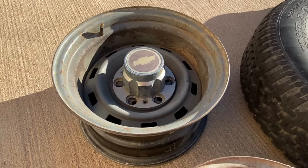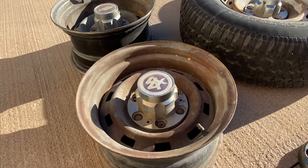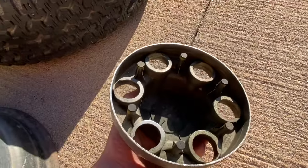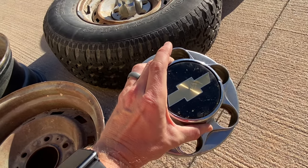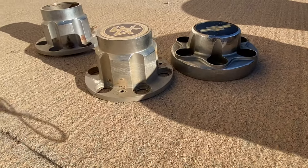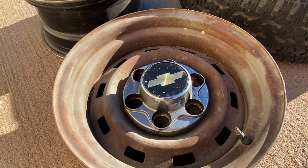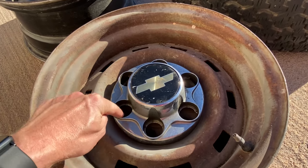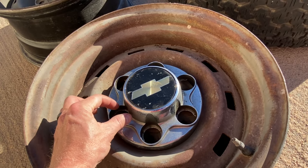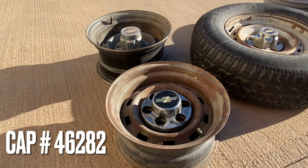It's not that bad if you ask me, but if you put these on a 15x7, I just think it looks terrible. An option you have is to go through and buy a set of these — these are 6-lug plastic chrome center caps off of a 1988 to 1998 Chevy. If you put these side by side with the 4-wheel drive caps, you can tell they're quite a bit smaller. The way these work is you'll stick them on the wheels, but you're going to need a conversion duplex lug nut — something that goes onto the wheel stud and then has threads on the outside of the lug nut — so you can take the plastic lug nut covers and spin them right on. I think this is a pretty cool option. I was able to pick up a set of these off eBay for $40.